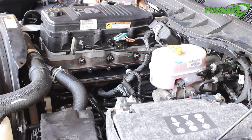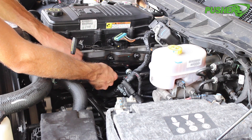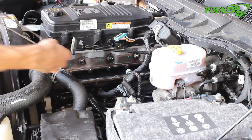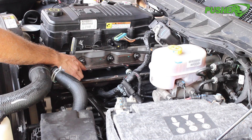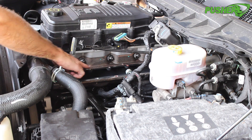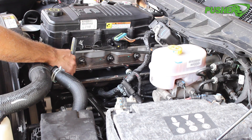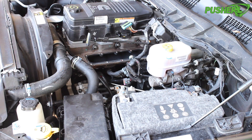So now we're getting ready for reassembly. You want to go ahead and pull out your factory heater grid gasket. It usually doesn't leave anything behind, which is nice. You don't have to clean up any gasket pieces or whatnot off the sealing surface. Although when you back out your bolts that used to hold your heater down, the sealant on those bolts usually disintegrates and falls down into the plenum. So you want to do a good shop vac job in the plenum. And then along this little edge, usually some dirt buildup and whatnot. So go ahead and vacuum all that out, get it good and clean. We're ready for reassembly.